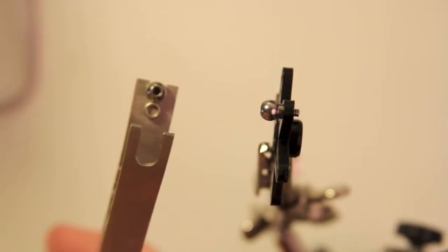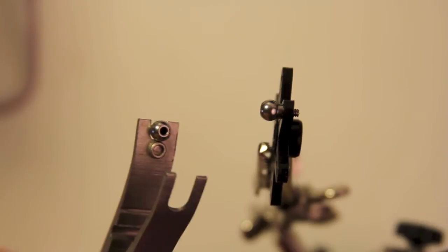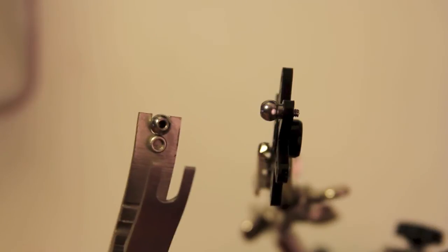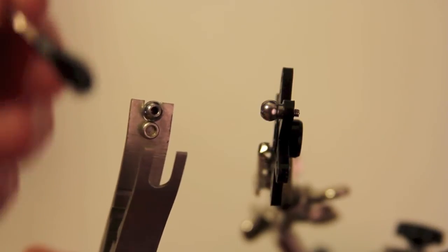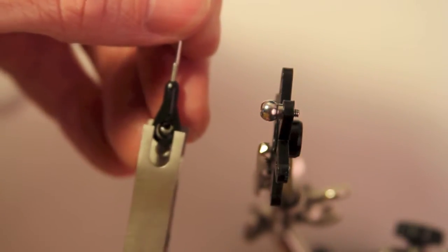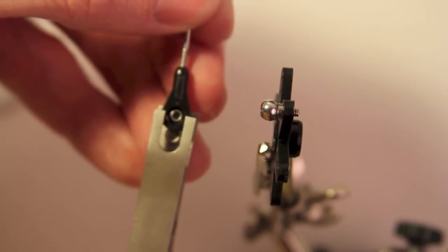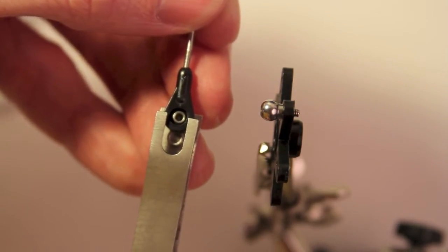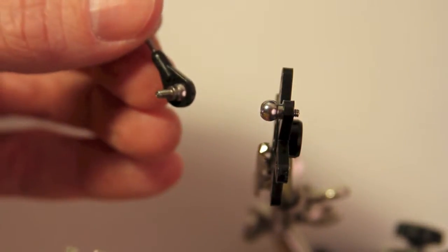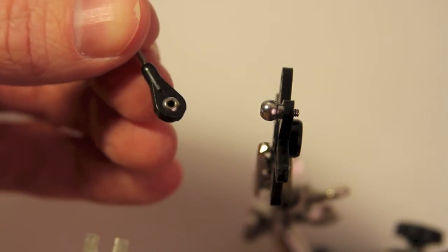So the little side here, the little nib, is designed to actually fit underneath a ball. And this is for actually installing the link onto the ball. And basically, keeping in mind we always want our A's out, right? You set the link on top of the ball, and then the wide horseshoe basically just pushes down on the sides and locks it into place, right? So there's a ball installed onto a link.